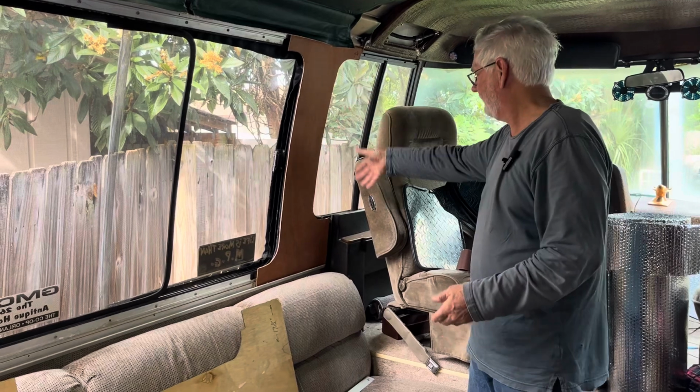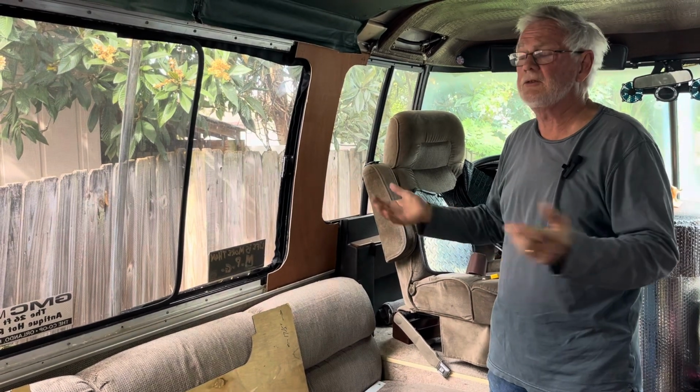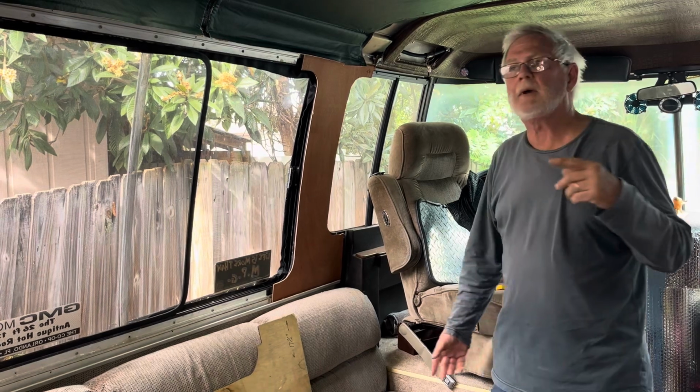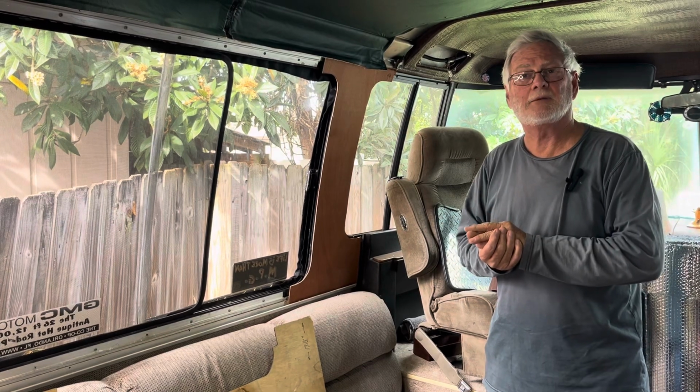You make it, say, well, yeah, that's pretty good, but if I had this corner here, make another pattern. The stuff's cheap. I mean, a 4x8 sheet of 1/8 inch is 15 to 20 bucks. Even at $25, the stuff's cheap. Okay. By the way, if you're going to do the entire coach, I would get 5 sheets. If you're going to do a headliner, which we'll have a video about, you want 5 sheets. So if your interior is completely stripped and you're going to do it the way I'm talking about, buy 10 sheets of 1/8 inch 4x8 plywood.